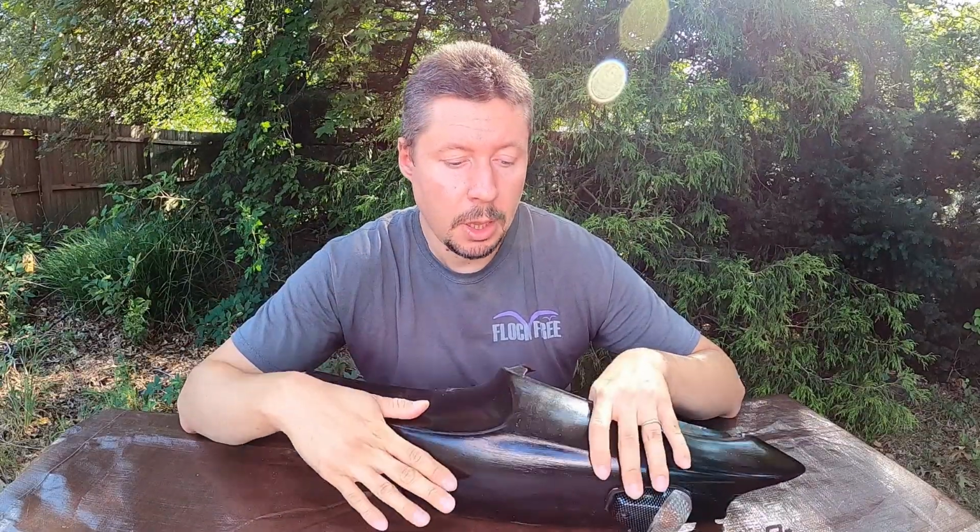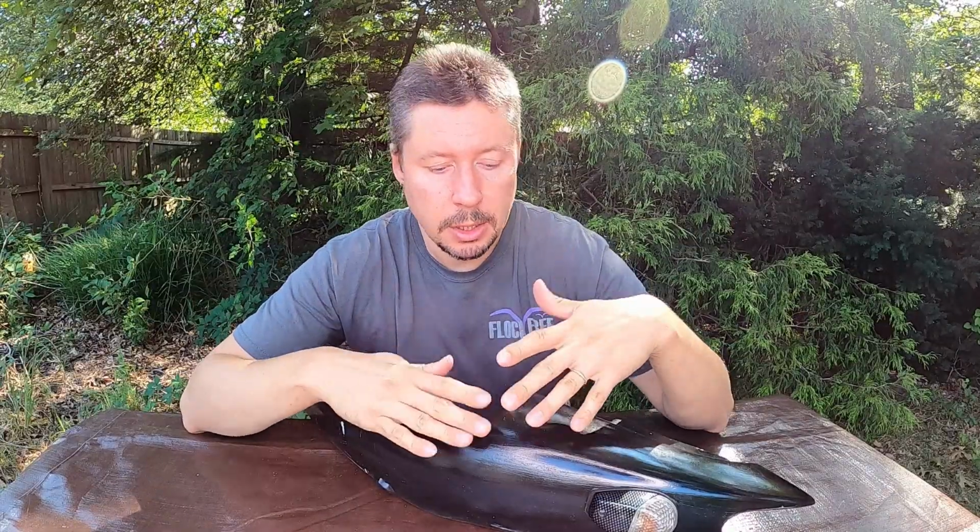And the preparation process is rather simple: you cut everything above this level and you fill everything which is below this level. Every painting job is different actually, every surface is different, and there is no universal recipe for everything. But in general, the algorithm is the following. You remove all old paint, if it's not factory paint. It's important, because if it's good factory paint and you just change the color, you can leave the factory paint as it is, and it's better to do so. You remove all loose paint, you sand it to a flat surface. If you have some lower parts, you fill them. If you have some higher parts, you sand them.